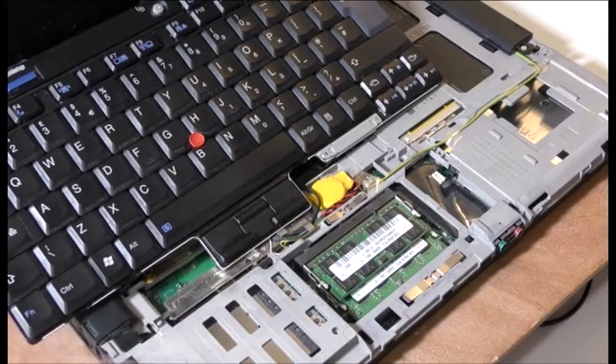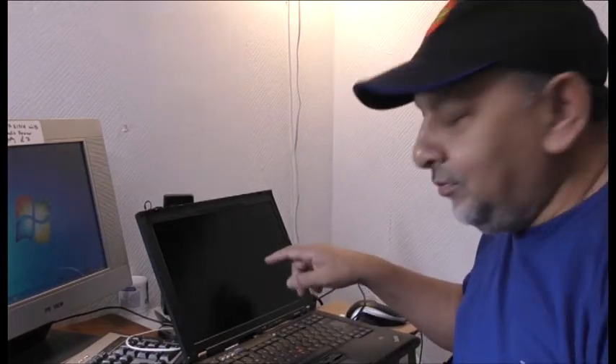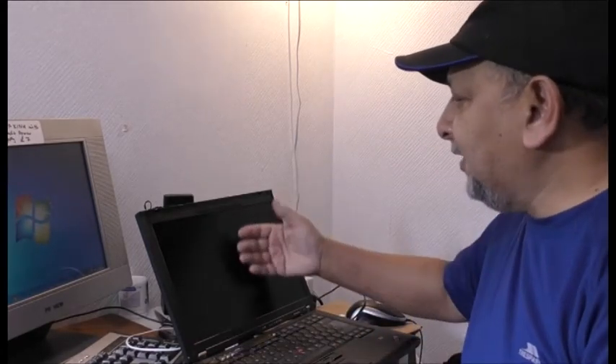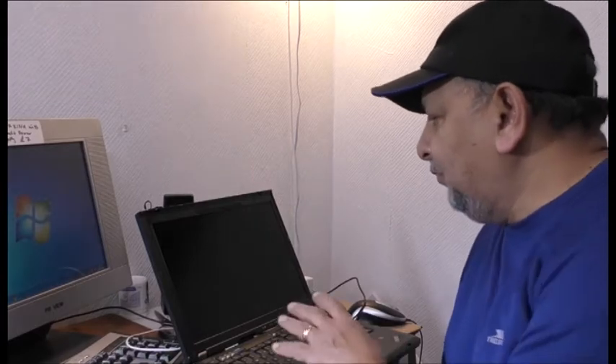So guys, I've changed the BIOS battery. Before that, the screen would just — the computer was just going off. Now I can faintly see the computer is on, and the monitor I've hooked up shows it is on, but it's very faint. I think that's a separate problem altogether and I'm going to have to investigate why, when you first start it, it switches off. Before, it wasn't even switching on — it was coming on then turning off — so the BIOS battery has sorted that out. I think it's the screen itself, because that's on but it's not coming on clearly. We'll see. Thank you for watching — thumbs up, subscribe, and any helpful hints are appreciated.